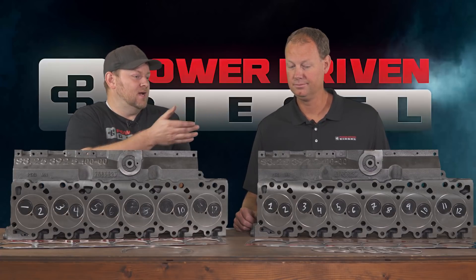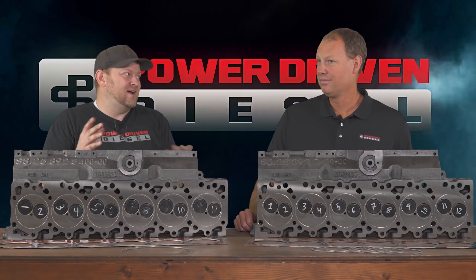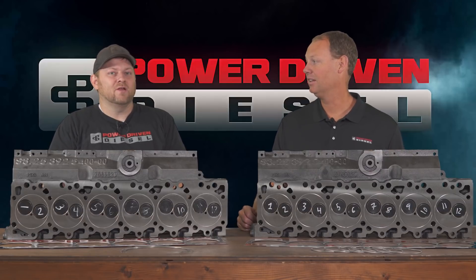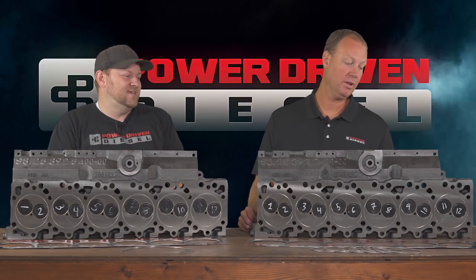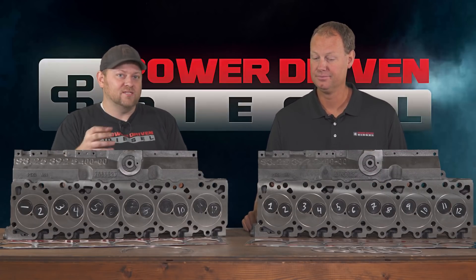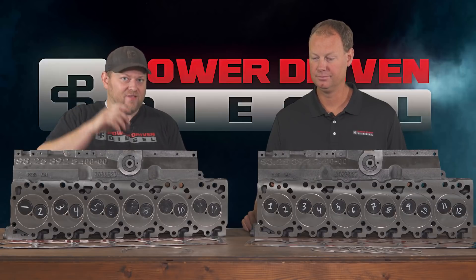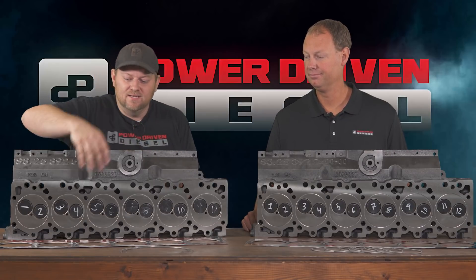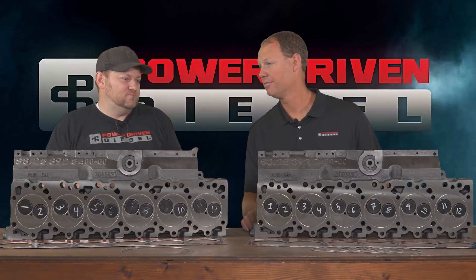For horsepower range, stock all the way up to maybe 700 to 750 horsepower is a happy top end for o-rings. If you've got a good set of heads you could probably go beyond that, but around 750 horsepower on a Cummins — which puts you well over a thousand foot-pounds of torque, maybe 1,400 to 1,500 to the tire — that's where you generally start having trouble with o-rings. The problem is you get enough power, the head lifts a little bit, and since there's so little crush left after the o-ring, it only has to lift a little and fire goes past it, cuts through all the composite material, and you start leaking coolant.